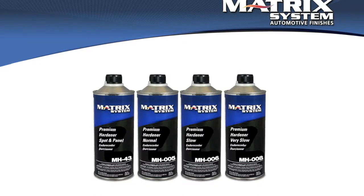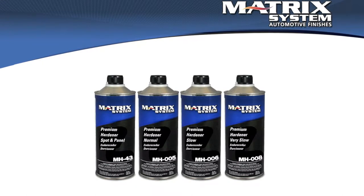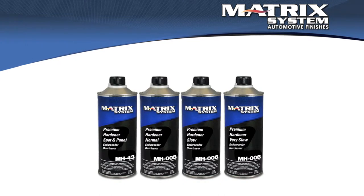The speed and the leveling of the clear coats is the same kind of issue. If it's too fast, we're likely to get more orange peel, maybe solvent popping, die back — stuff like that — associated with excessive film build. If it's too slow, we're going to waste time, we're going to have extended dry times, running, and difficult handling. So we want to pick the hardener that's going to give us the flash time appropriate for the job size and the temperature.